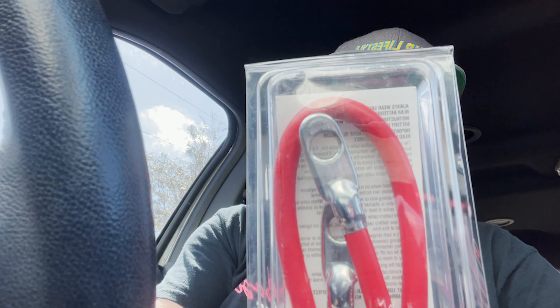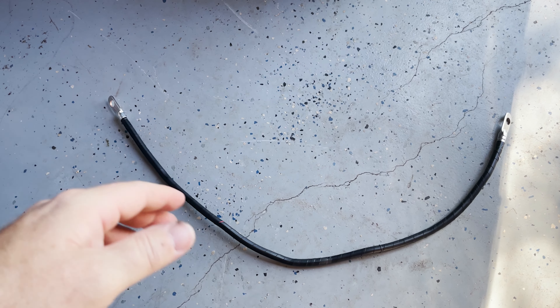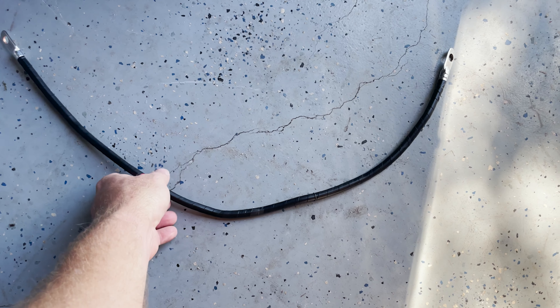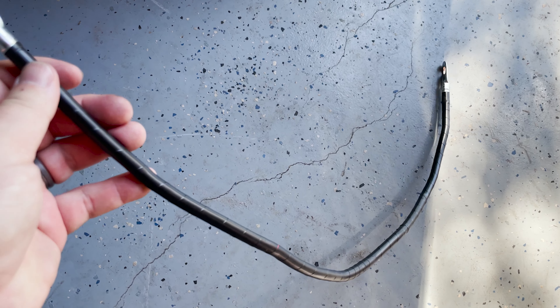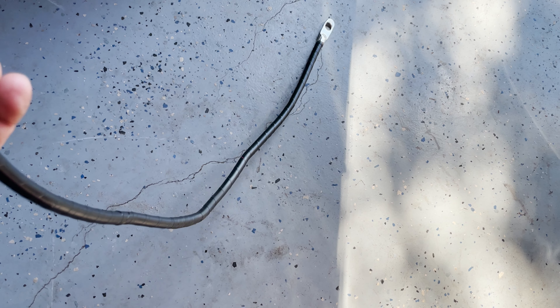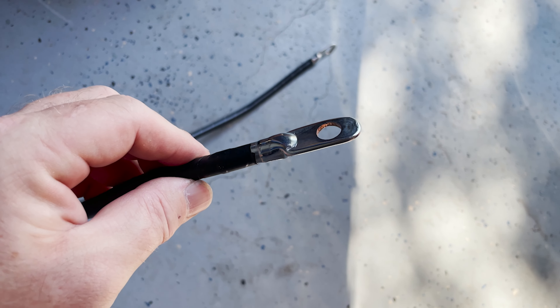Just like that — they had one or two in stock. I like those ends, man. They're crimped on. They're nice. Let's get home and get this thing on there. I'm back at the house. I did not have any tech flex, and I started thinking there's no point to really put that on anyway, only because where it's going down by the exhaust, the tech flex is kind of a plasticky material and it just wouldn't hold up under that much heat. There's no need to do this, but I just did it anyway — I took some new black electrical tape and crossed it all the way down. I did that because it'll kind of hide the red, and I can always keep an eye on it to make sure it's not getting burnt by the exhaust in any way. I'll be able to quickly tell if I see a lot of red. I'm going to route it in there now and try to keep it away from the exhaust.